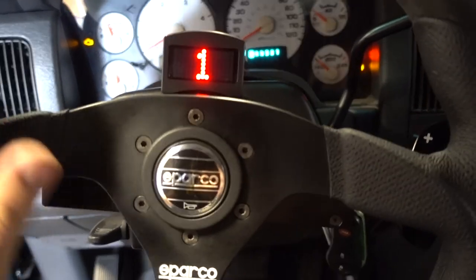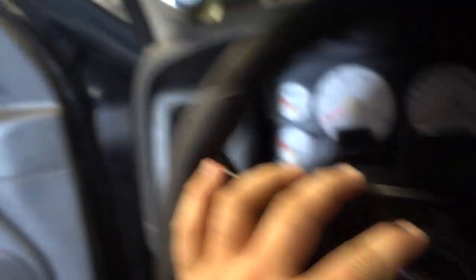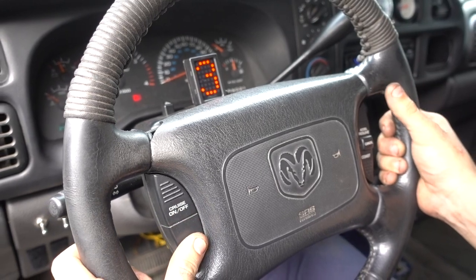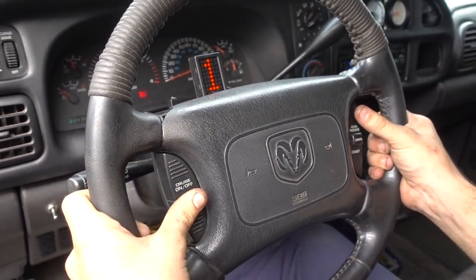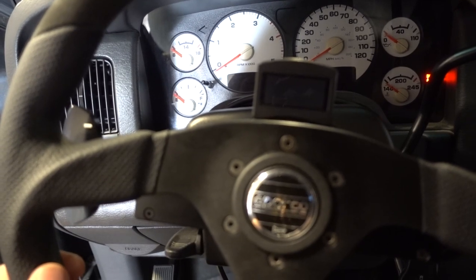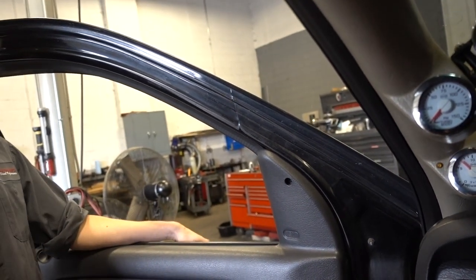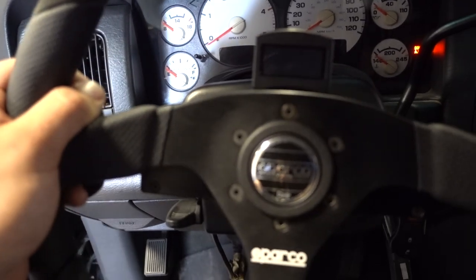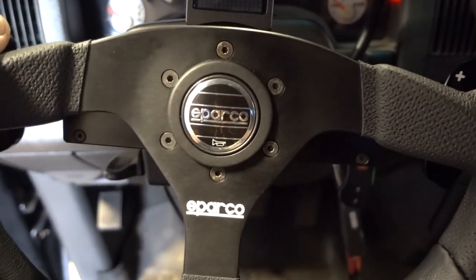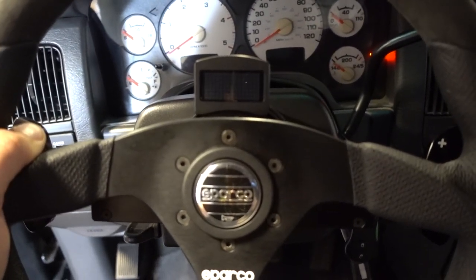There were a lot of questions about using a different steering wheel. Abe's truck over there is actually using factory buttons on his steering wheel. So technically, if you could adapt a wheel to this truck, you could use that wheel and the electronic buttons in it for those functions — like an aftermarket six-bolt wheel that already has buttons. Or even if a different wheel, like an SRT, Jeep, or Dodge wheel had buttons on it, you could technically use it. It'd be more challenging and there's going to be some machining involved, but this looks cool — it looks like it's ready to go fast.